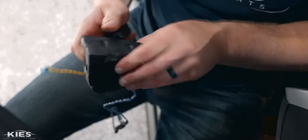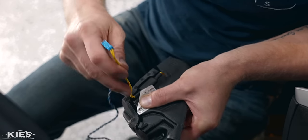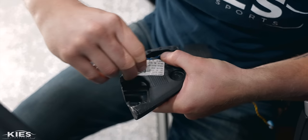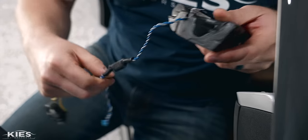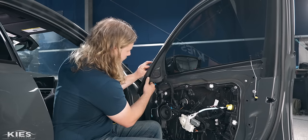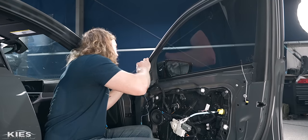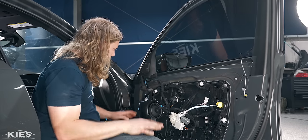Now we're ready to install the Beamer Tech Alpha 1 tweeter. Take a look at the foam — flip it over, move the sticker out of the way, and remember how it goes: down, out, and around. Your new tweeter goes in, around, up through here, and then down. The Beamer Tech one sits a bit further down because it's wired slightly differently. Just bend the wire back rather than removing it — it's a pain — and then clip it in. You'll hear the audible click, then push the foam back into place.